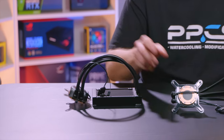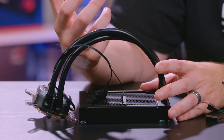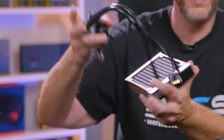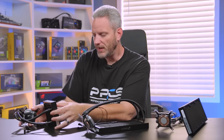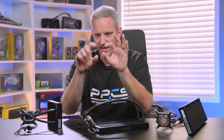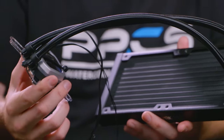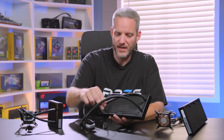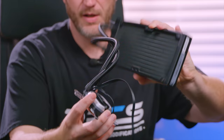Something that can also impact the price of your cooler is the quality of the materials used. The H60, being more entry-level, features a rubber quarter-inch tube — highly flexible, as you can see. I'm not a fan of FEP tubing; if a cooler has FEP, it's very rigid and stiff and wants to do its own thing — that's my least favorite tubing on the market. As you move up the product line, the H100i Pro features a sleeved tube — same tube underneath but with a paracord-style sleeve on top, giving it a more premium look and feel with the same flexibility. All of the coolers feature a rotatable fitting on the pump so you're not putting excess pressure on the barbs, which could crack over time.